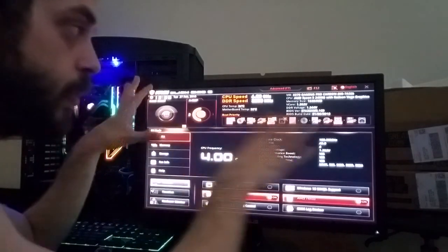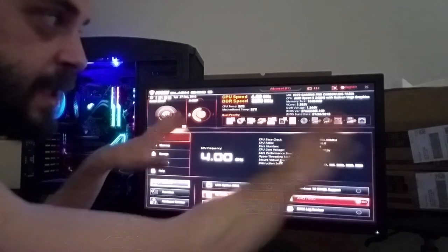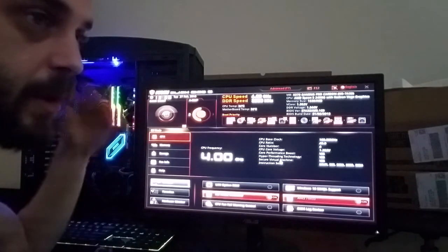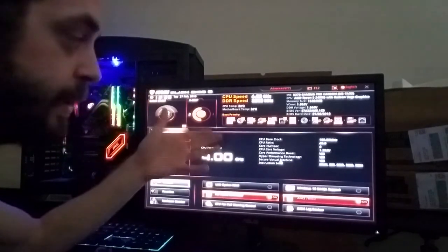And it'll say, warning, do not turn off the power. Your keyboard and your mouse are deactivated while this is happening, so you can't mess with anything. A little loading bar will move across the bottom of the screen, and it'll flash your BIOS, everything will restart, and you are done. It's that simple. It really is, man.